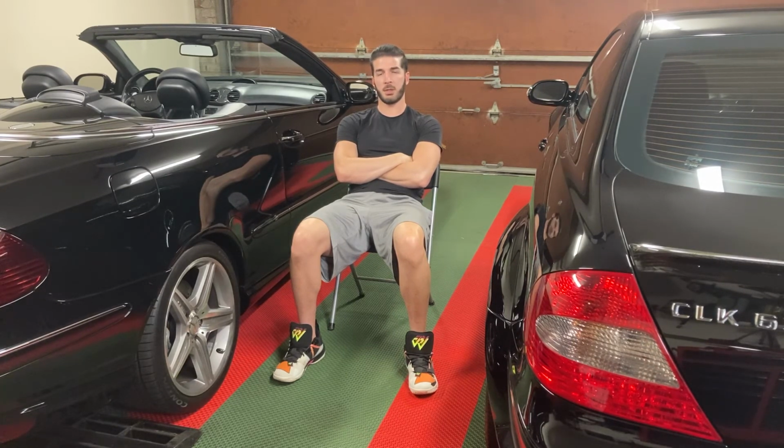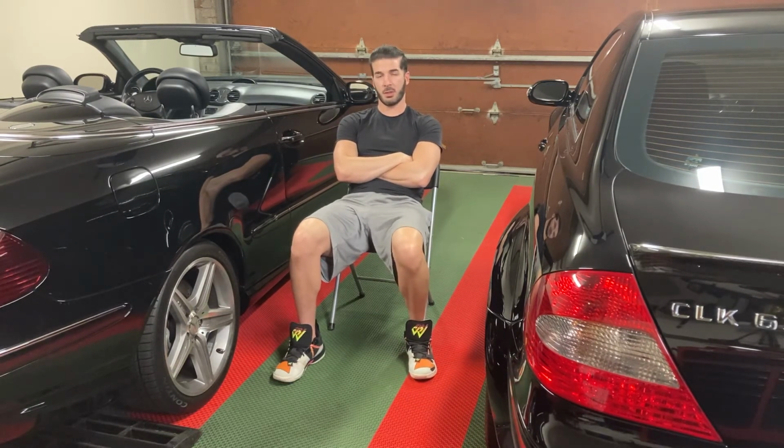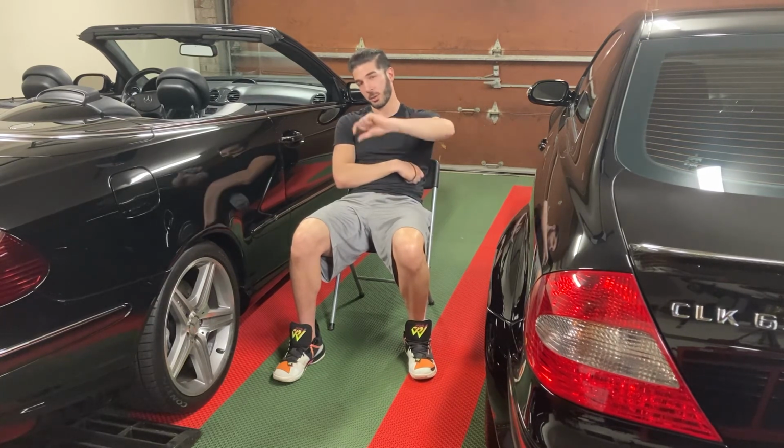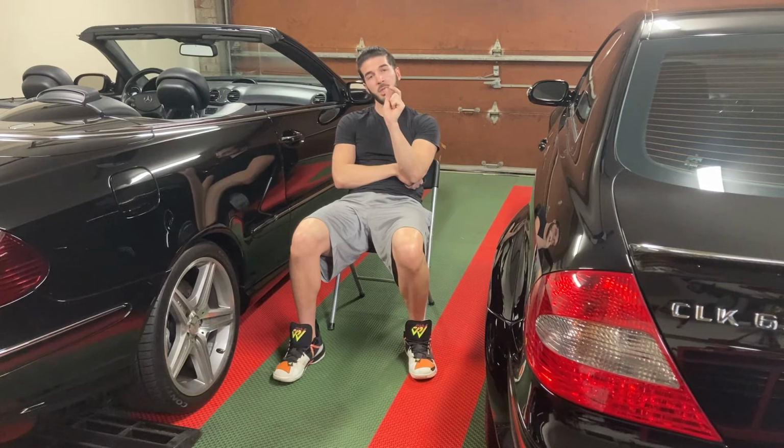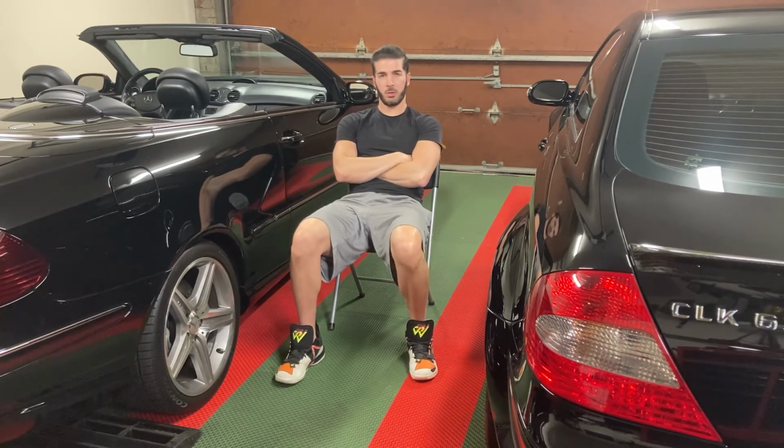You might see them on Instagram and things of that nature. I've seen people install the same kits, and you'll notice if they actually took the time to put the body on right, because that front fender lip on the bumper that comes around where the headlight is, there's actually a 2mm gap, which needs to be reshaped. Most people don't do that because it's too much work. The other thing is where you trim the front bumper to make enough space for the body kit to work, you end up practically cutting half of the stock mount off. So you have to recreate and glue that back on so that it holds on nice and tight.